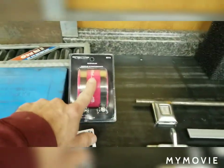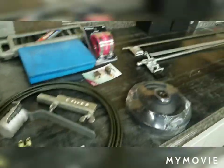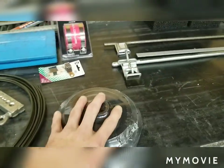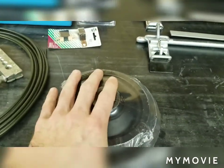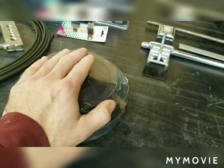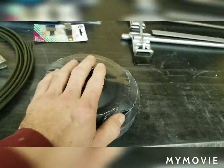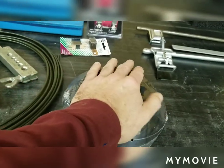I'm going to go ahead and change the coupler on the intake. I've got brand new brake line here to go ahead and do that. Brake bias valve. I've got a brand new harmonic balancer. Since these are known to separate, I've got two that are original to the cars, and they're just really old, so I can't risk that failure. So we're going to go ahead and put a new harmonic balancer on it.